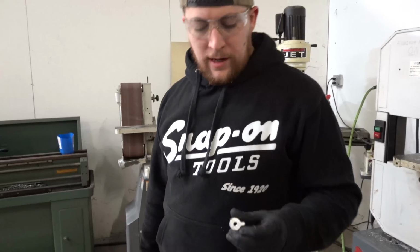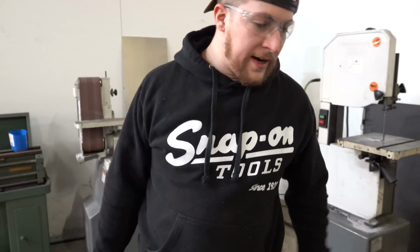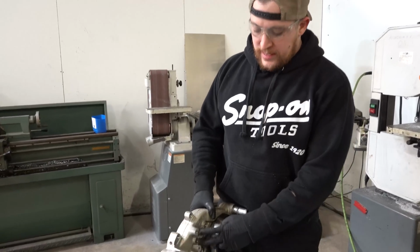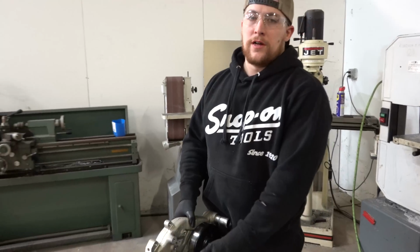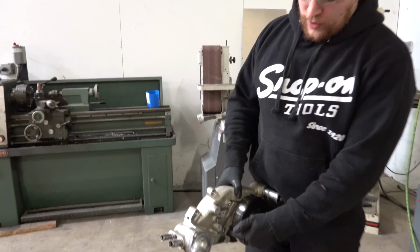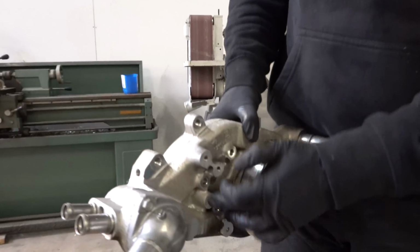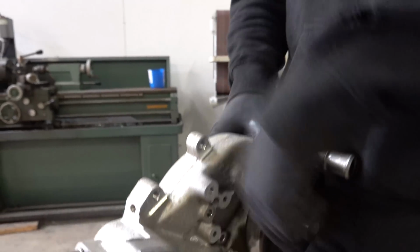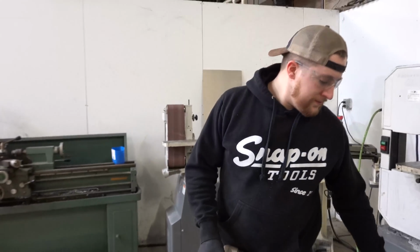From the 09 and up, the water pumps for A&A kits. It's a similar one to the 01, so it's got dowels like an LSA one for the bracket for idlers. So all you have to do, if you have an 09 and up, is cut these four flush, because the belt routing for the A&A kit is going to go right there. Oh, okay.